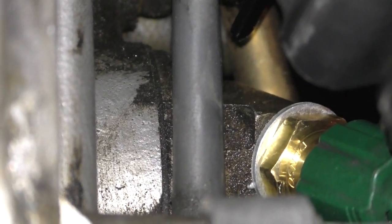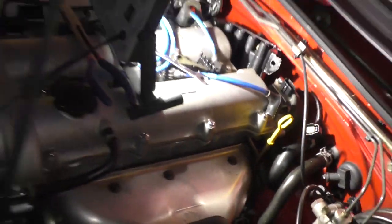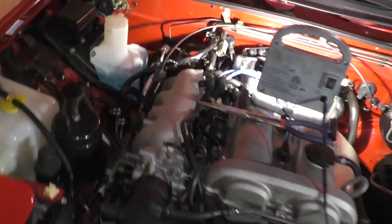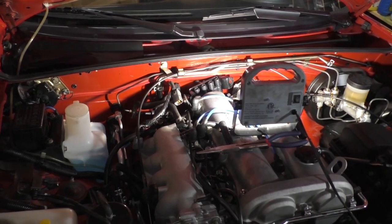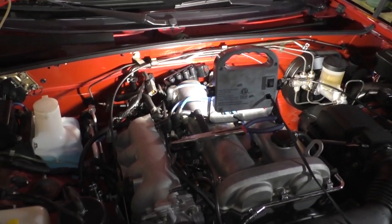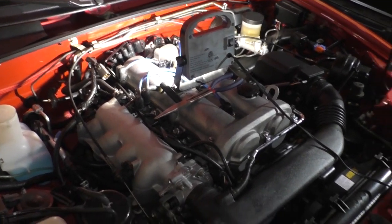What happened was, when I put the coil back, the wire got stuck and was grounding out against that right there. See it? So we've got to check that wire for any major damage before I reassemble it. So when I torqued down the coil pack, that wire got in the way and pegged the sensor. Shit happens. No damage would result.